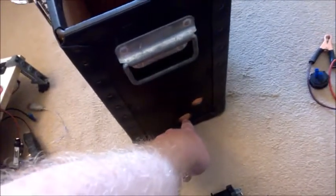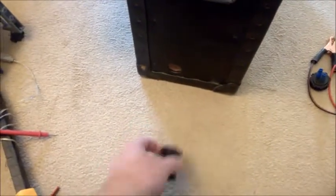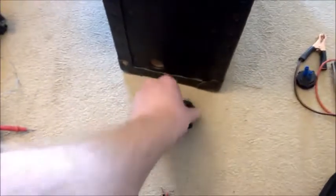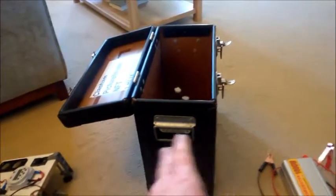On this side I'm going to drill — five in total, four more. I'm going to put in a 12 volt socket, USB, USB, a 12 volt socket in here, and then a voltmeter at the top. So that's my power output. The inverter is going to go inside because I hardly ever use one. This is mainly for camping and radio stuff.